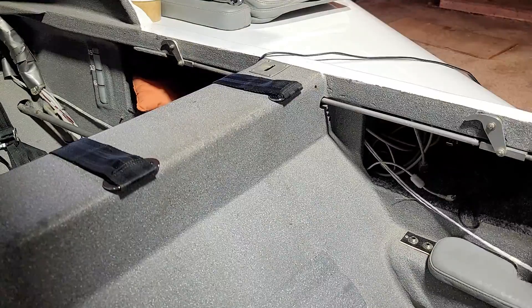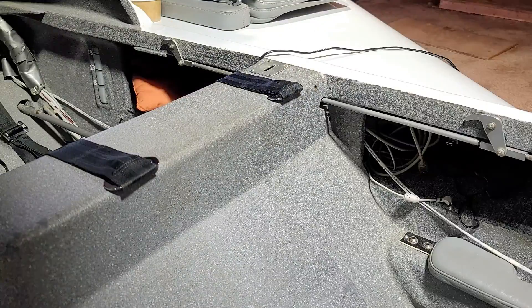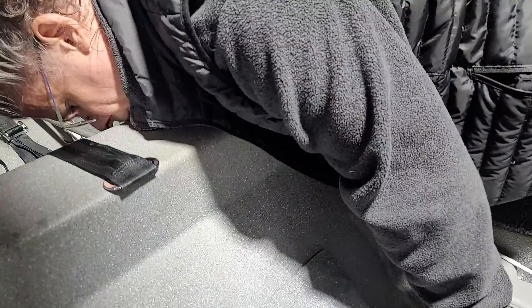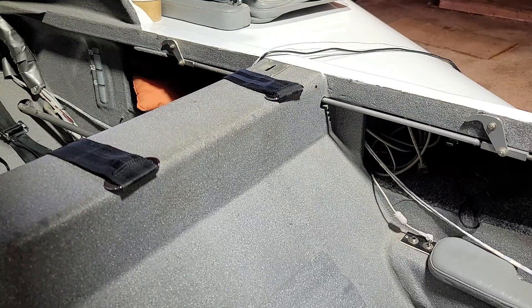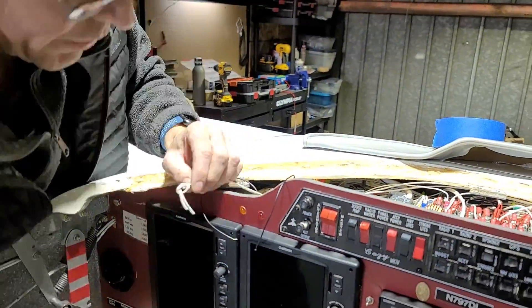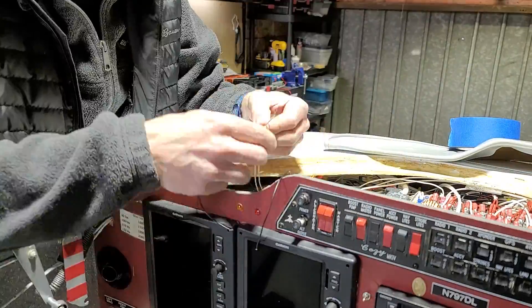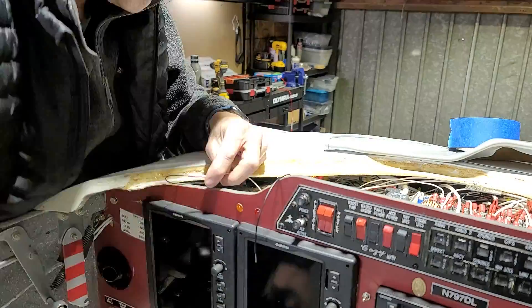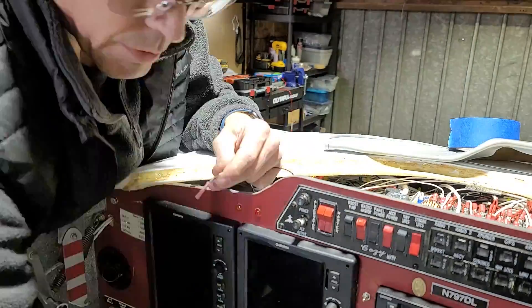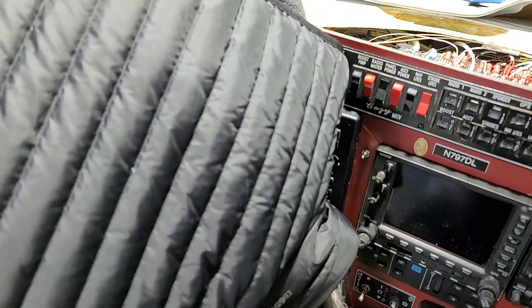Here I am pulling wire all the way to the back because that's where the EIS module is. Unfortunately it's right at the back because that's where the engine is, which means every time I want to hook up something to the EIS that's up at the front — be it switches or anything else — I have to run wires all the way to the back. Now I've done that and I'm crimping everything together. I've actually cut the wires down in the footwell and put a couple of connectors in there.